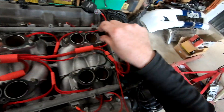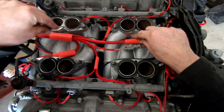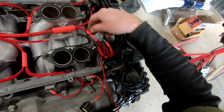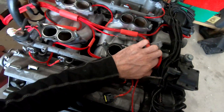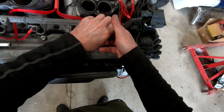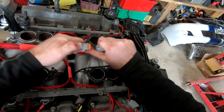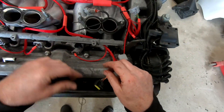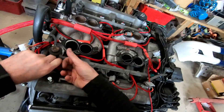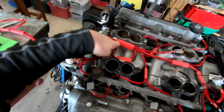I've just got a little bit of shrinking to do in here, and you can see that it will have a clamp there and there. Lovely — just sits on there like so, cable ties in, nice and easy. Also in here you will see a knock sensor loom and this one is black; there is a red one that comes with this loom. The injector plugs actually have the numbers engraved on them for which cylinder they go to. And the oxygen sensors — you probably can't see much under here — have also got left and right engraved on them.